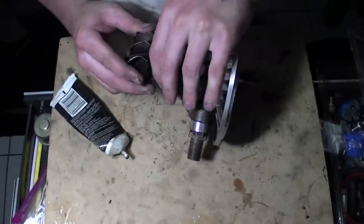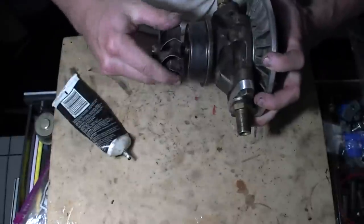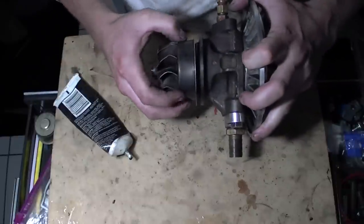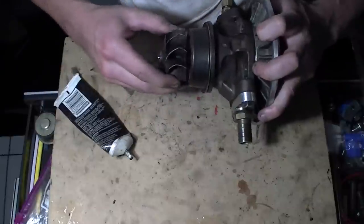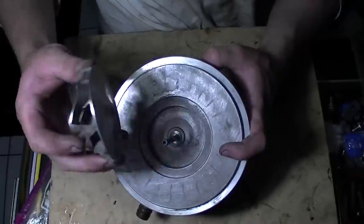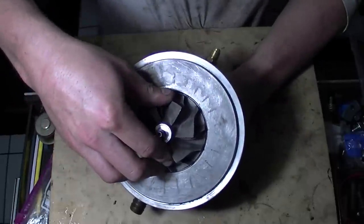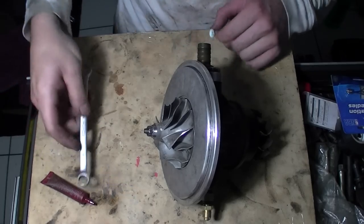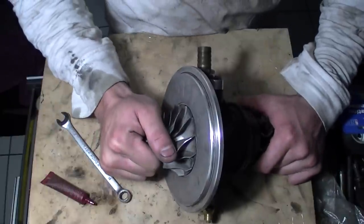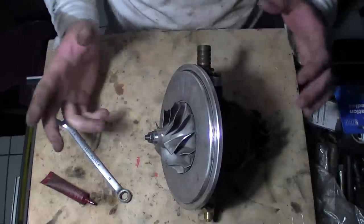Be careful with that piston ring. Once you get that in there, just kind of wiggle it a little bit with little taps - make sure that piston ring isn't going to get stuck. Give it wiggles back and forth, pull it out if you have to. The piston ring went in real nice. Put that back on like that - remember it's lefty tighty, righty loosey. I torqued it to what I felt was right - I have loctite on there and torqued it until it was just tight enough with no movement, probably around ten foot-pounds. With the loctite on there, it's not coming off.